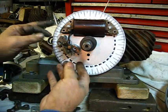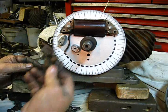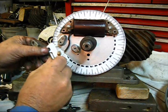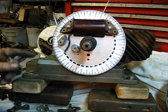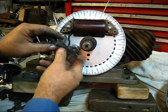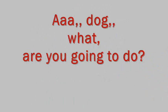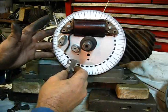You wonder why I brought this example out. If we had this, we wouldn't need to know how to adjust them — we're stuck with this type or this type. This will not go on there because of the pins; only one set of points will fit on this backing plate that is drilled for the pins. Remove the pins and then any points you have will fit here.